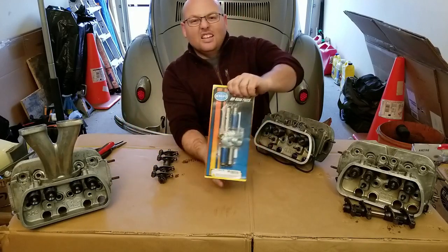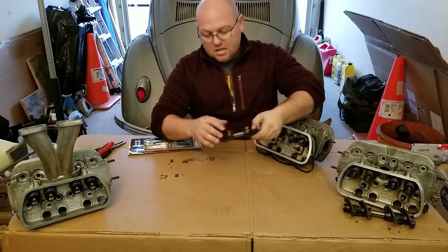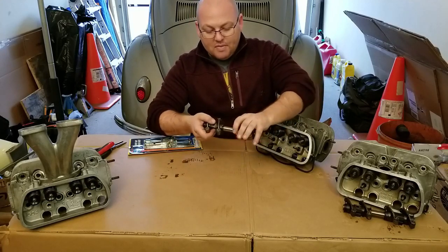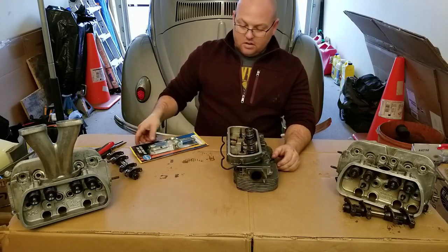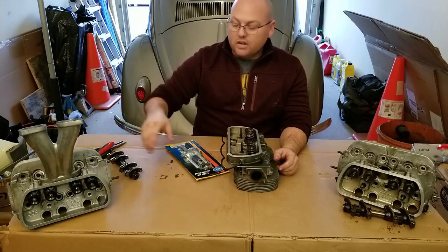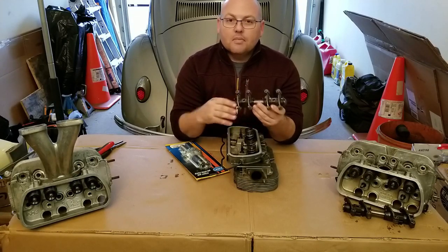That's where we bring us to this. This is a solid rocker arm kit. And what it does is it replaces these clips on your rockers and also the wavy washers that are inside of here. Now, what happens is whenever you end up upgrading, either you get a bigger cam or you get a larger setup like this over here, the amount of stress that's put on your stock rocker arms increases quite a bit. I'm going to go ahead and bring you guys in a little closer so we get a better look at this.